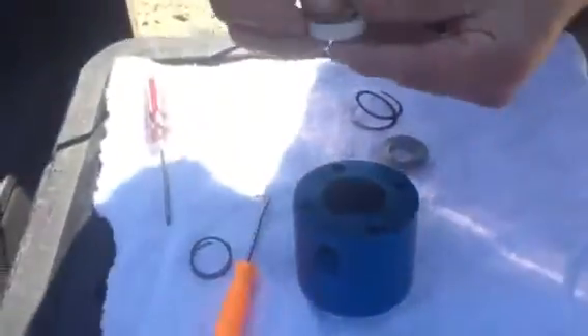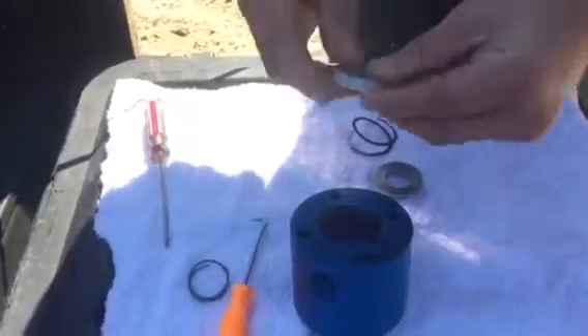I'm sorry, I have that backwards — you're going to want to put the O-ring facing up. It's a tight fit; the seal is a tight fit. I'm going to push it all the way down where you can see the O-ring. Then your metal spacer is going to go with the lip facing down, and that slides right in there just like that. Now you've got to work everything down to where it clears the side hole. You'll see a lip, and then just like the top side, you're going to put your metal clip in — feed one side in, spin it all the way down into that little groove, and it's there.